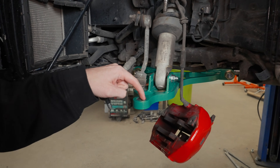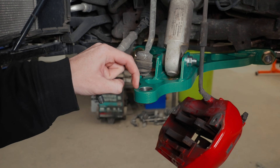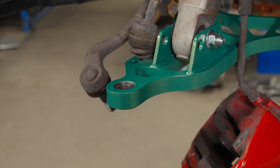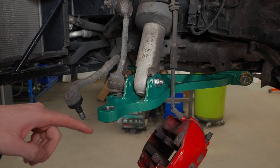Fortunately this cup here was actually a pressed-in component in the stock arm, so all we needed to do was bore it to size and then press in the OEM taper so the ball joint fits in. We also needed to shorten the bolt here, and I had some motion ratio options.